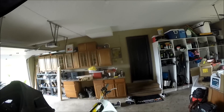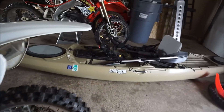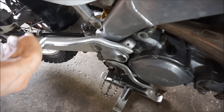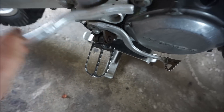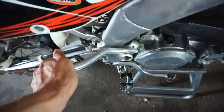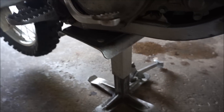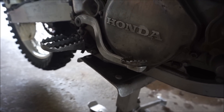We're going to switch the camera and talk about it. Man, that sucks. So I just got done taking this thing for a ride and I don't know if you guys can hear it — it completely bogged down and it just ran out like it was running out of gas. And now I have zero compression. If I go hard enough it will compress a little, but usually it has that break in there and now it doesn't — compared to my CR250. Something's definitely wrong. I hope it's just a ring. Maybe a head gasket or something.